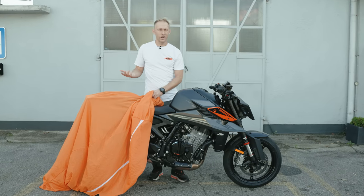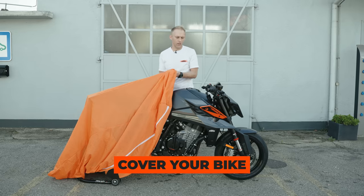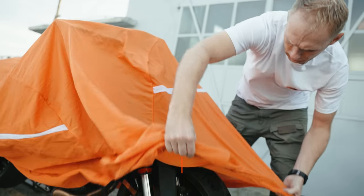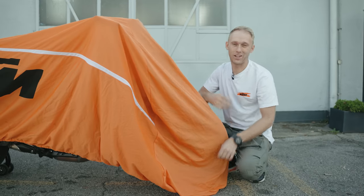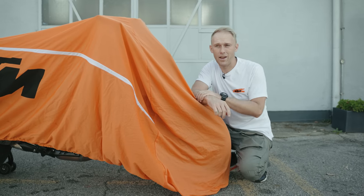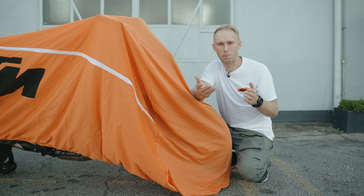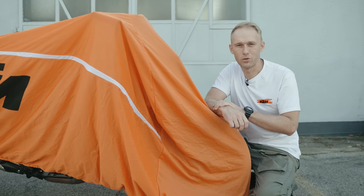If you don't own a warm and dry garage, then you need to park your bike outside. I suggest covering the bike to protect it from the sun and moisture, because metal doesn't really like water and that can lead to corrosion or rust. The sun is also dangerous, especially for paint and leather seats that can crack, and anodized parts can lose color because of UV light.